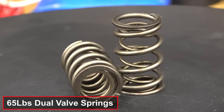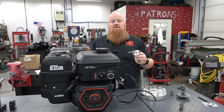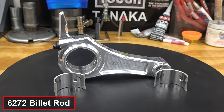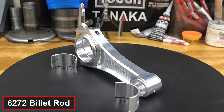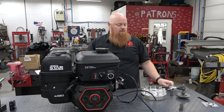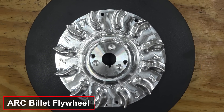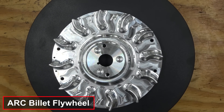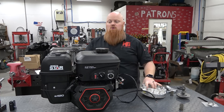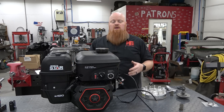With that cam, this comes with some dual valve springs. We want to make sure the head can fit these dual valve springs and make sure we're not going to get valve float. And then, since we're going to have the head off, we're going to pull the piston out — first off to see if it's a dish piston, and can we put a flat top in it? Then we're going to try out the ARC 6272 billet rod. The best thing about this is, of course, strength and longevity, and it has insert rod bearings just like a car would have. This is going to give us a ton of strength, so we're hoping it will drop right into the block. The last thing is we do not know how the ignition system works — hopefully we'll be able to fit this billet flywheel on there, but probably not because of this being an ECU-style CDI ignition. It's probably not going to use this, but we can at least see if the taper is the same. Unfortunately we're going to be pulling apart this entire engine to do so, and if the stuff fits, we're not going to put stock back in it. We're going to leave the performance parts and get ready for our performance build with the standalone ECU.